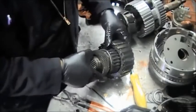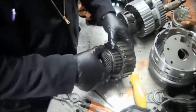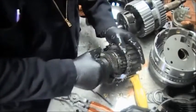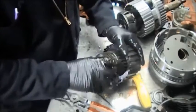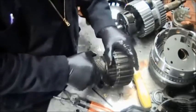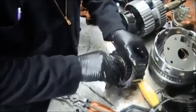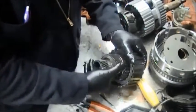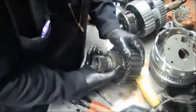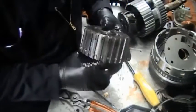What you have to do is turn the hub so that the teeth within the clutches align with the hub splines. They have to go all the way to the bottom — you will hear it because it will clunk. Turn it to engage with every clutch that is inside that drum.